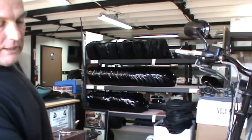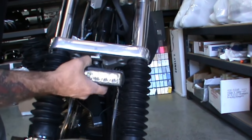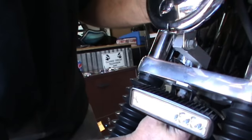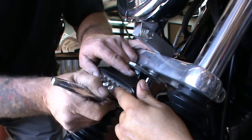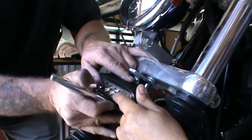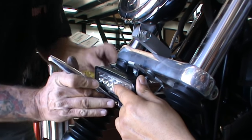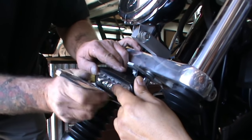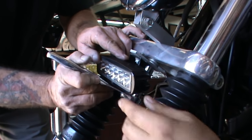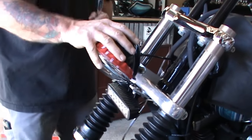The headlight will be laying down. So you've got the long bolt — it goes through the bottom of the triple tree, and there you have the headlight block. Snug the light back up, but do not tighten it all the way yet. The light's still loose. Fold it down out of the way.